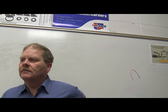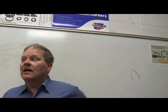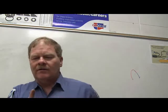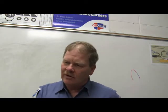Jeremy, what do you think? What else can make the red brake light come on besides the park brake? You guys are smarter than this. If it's low on fluid, it'll come on. Yep. Or how about this? If you've got a situation where you've got different pressure in the back and the front because you've got a leak in one part of the circuit, it's going to move that little thing off center in the proportioning valve. It's going to fire up the brake light, so you'll know there's a problem. In that case, you'll usually feel something wrong with your pedal, too.